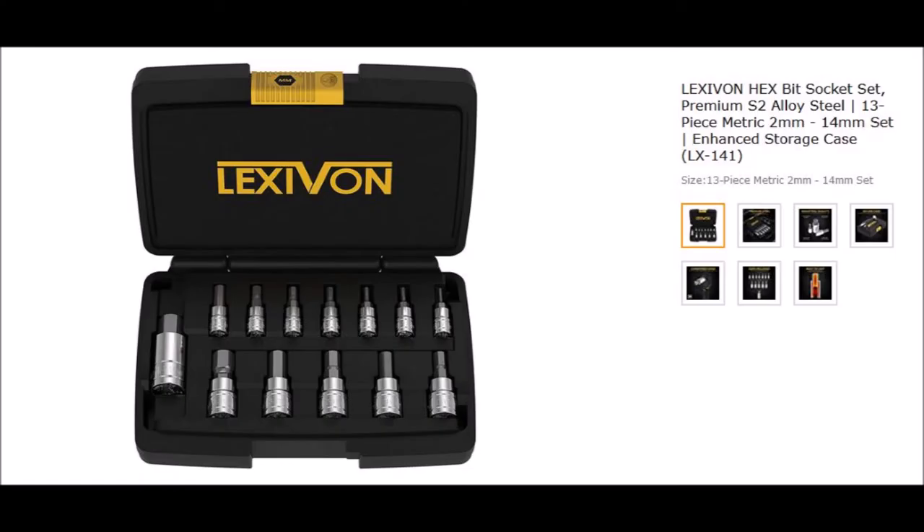For cases where you can't fit your torque wrench, these hex sockets have a male hex fitting that sticks out in different sizes - metric and imperial. You put this on your torque wrench, then take a box-end wrench and slide it through one of the hexes - it's basically an extender for your torque wrench. There are calculators out there that will tell you how much torque to give it once you've extended it, because the longer the lever changes all the torque characteristics. I find this very helpful though I won't use it in this video.